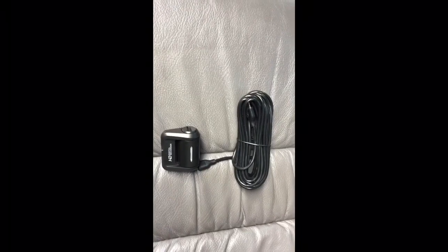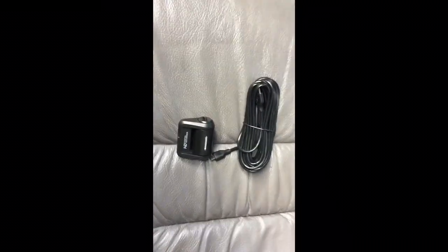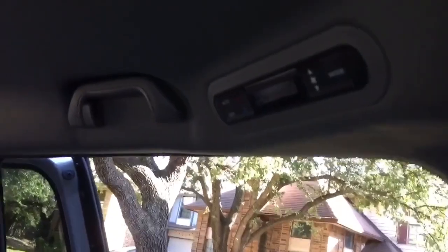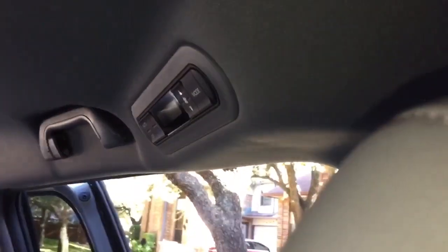After installing the front camera, I'm now looking to install the rear camera. I have to run this big wire all the way from the front camera to the back of the vehicle. What I'm going to do is have this wire installed on the driver's side of the headliner and run it in the weatherstripping, then continue to the end of the vehicle. I'm putting it under the headliner and taking it back to the third row at the tailgate. There are one, two, three pillars and all of them have airbags, so I have to be careful not to deploy them. I've successfully pushed the wire past the first plastic joint, and now I'm at the second pillar.